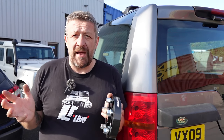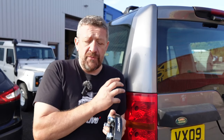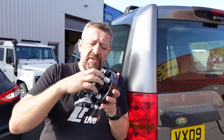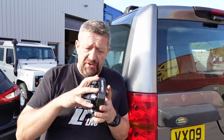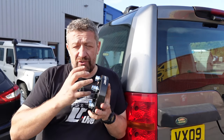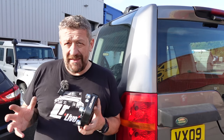I've said this before on the Defender — there's no real difference in my mind to fitting these than fitting a steel wheel or an alloy wheel with a greater offset, because you're not putting any more or less strain on those axles. But these are hub-centric, so they've actually got a shoulder inside that takes the stress away from the hub. Unlike normal ones which are just a spacer, this shoulder distributes the stresses into the wheel. Gone are the days where you just say no to a wheel spacer — there's more to them these days.